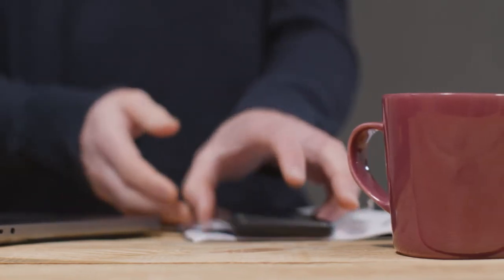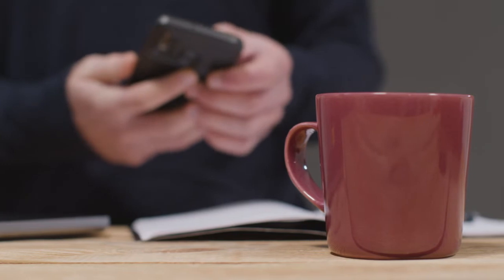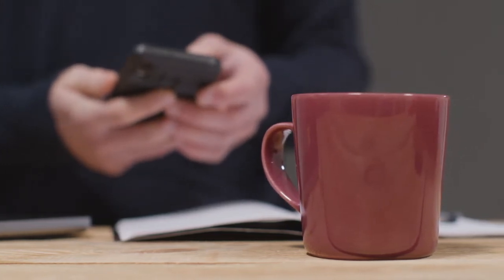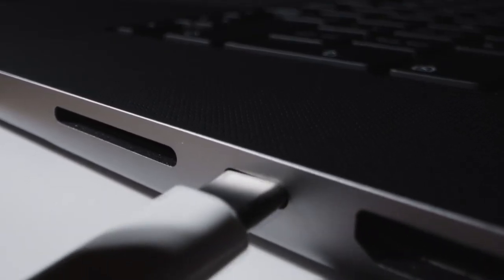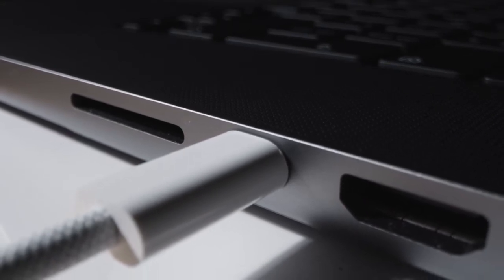You need to do it with great precision and care to avoid damaging other parts of your phone. To do it well, place the gun's tip over each of the original solder joints and hold it for several seconds until the solder starts to flow outward. Then, use the tips of pliers or a similar tool to pry up the solder. You can then gently remove your charging port, ready to replace it.